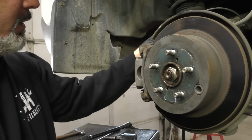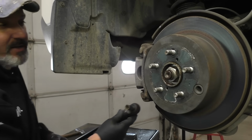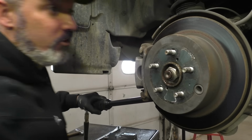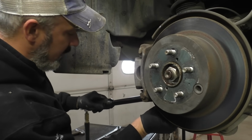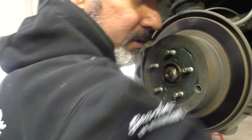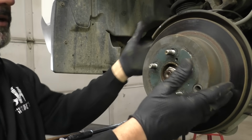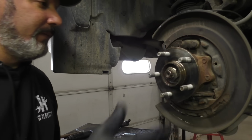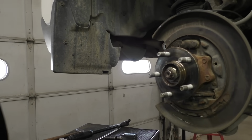I initially grabbed the 13.5 millimeter from Astro Tools. They make half-size sockets, which are great in the Northeast. And it didn't fit. But there is no size between 13 and 14, unfortunately. No imperial size, anyways. So the half-size sockets are really nice. Just push that piston back. Stick those up there, so everybody says. Ha! I was right. Well, I laugh, but we still gotta get that bearing out without destroying it. Then we'll see who's laughing.